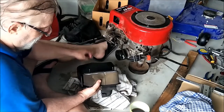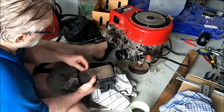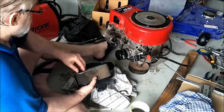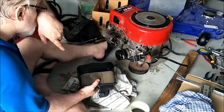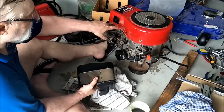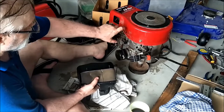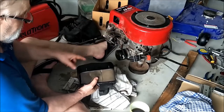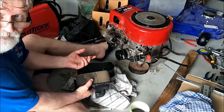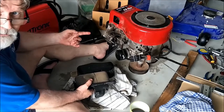So, you know, if you've got a bottle that has a tiny, tiny leak, over time it will leak out. But it shouldn't be in the intake. I mean, the rings are supposed to basically seal this side. So in the piston, in the bore, you have your rings, and you've got oil in the crankcase here, and the rings are basically supposed to stop the oil coming past it. But if he had it laid on its side, which he did when we first saw it,